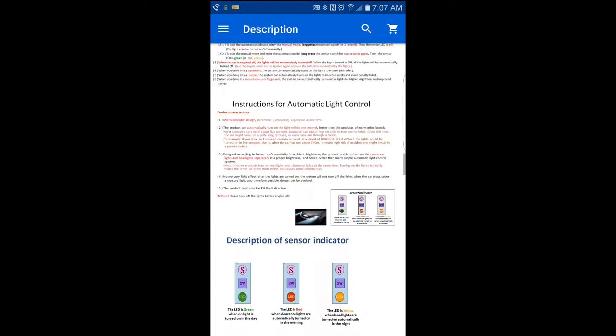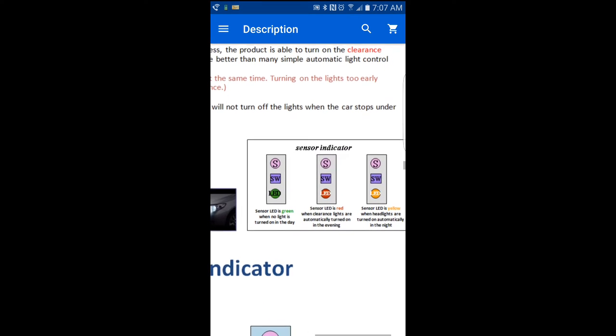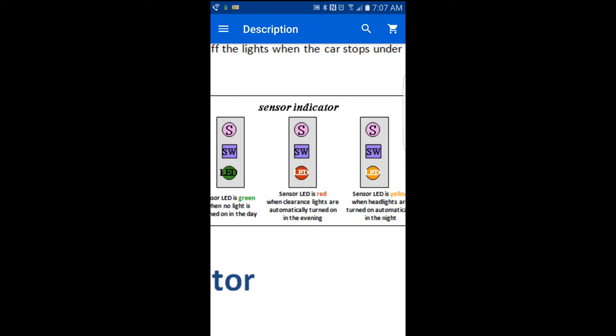The LED on there has three different modes. If it's daylight, it'll be green, and your headlights will act as normal — your switch to turn the lights on works as expected. You're driving around, you turn your lights on manually, they turn on, they turn off, everything's totally normal. If it gets towards dusk, the sensor LED turns red. In that case, the lights will automatically come on. If you try to use the headlight switch in the vehicle, it's completely overridden — you can't turn the lights off or on unless you really want to, and I can explain that later with the button.